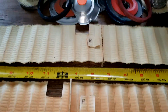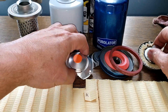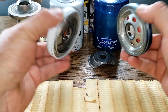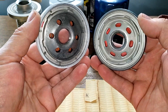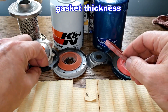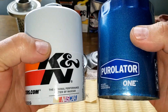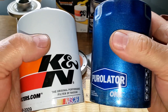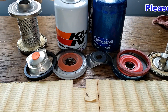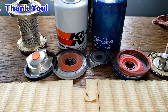Looking at the rest of the filter: both have louvers, the Purolator is taller, and they have different bypass valves — that's a matter of preference. Both have silicone anti-drain back valves, and the base plates are a little different. I think you'd probably get better flow out of the Purolator 1, and the gaskets are pretty similar. The biggest difference is the can — I give the can win to the K&N, plus it has a removal nut. But the Purolator has a nicer paint job. So which filter do you think is better? Don't forget Oil Filter Friday — I open a new automotive oil filter every Friday on this YouTube channel. If you liked this video, hit the like button. Thanks for watching!